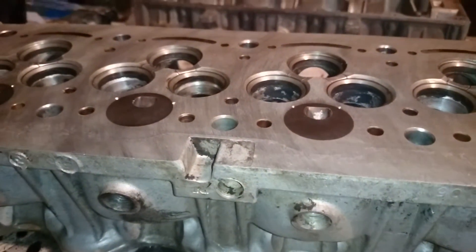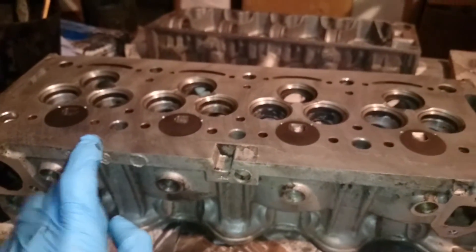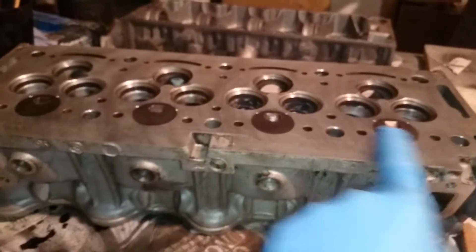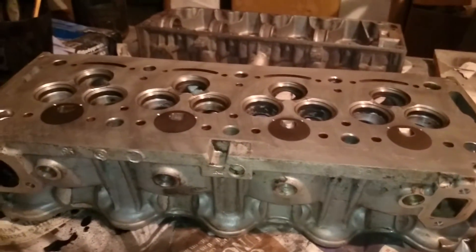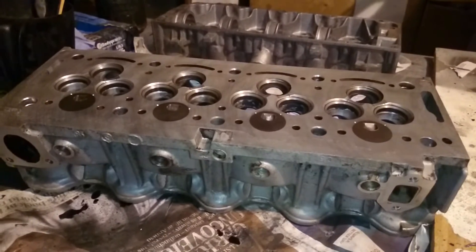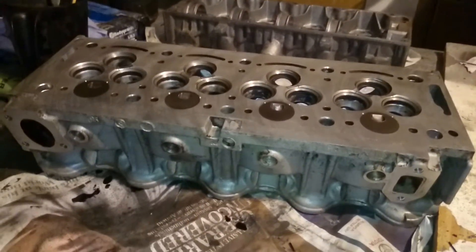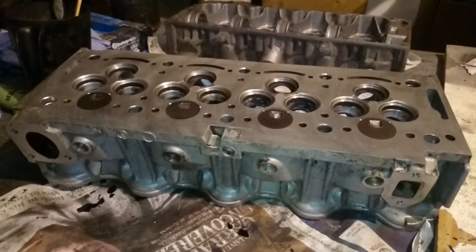You can probably still see the marks from having the head skim — the grind done. Only a very light one, but you have to do it slightly differently so you don't get that polished look you might have with usual skimming, because they use a grinding stone due to the surfaces involved on this head. So the next stage is to finish doing the ports — I hadn't really started on the head — and we'll get on with that in a bit. But for now, that's the head back.